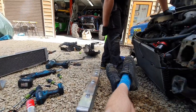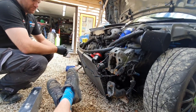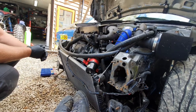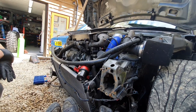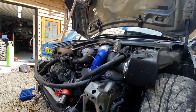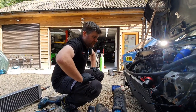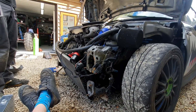We've got our plastic front panel off — it's over there in many pieces. As well as hanging this metal bit across the front, we've decided to move lots of stuff. We're going to redesign this pipe to a completely different setup, move the throttle body from pre- to post-charger and put it on the end of the inlet manifold. We're going to get a slightly different throttle body purely because we can — it seems sensible and gives us a load of extra room around where our charge cooler is. More improvements, still no brakes.